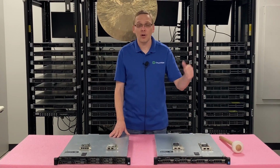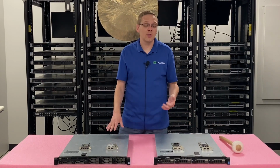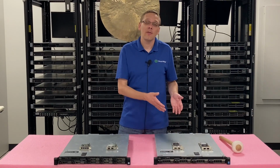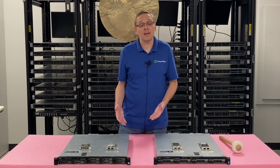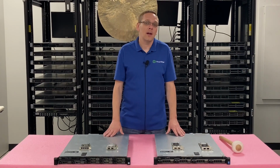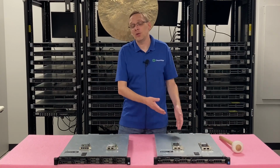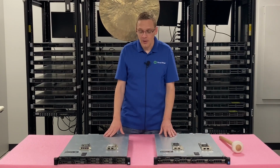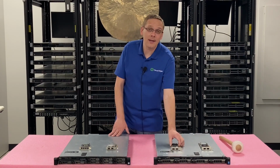There is a mini mono, as you see in our RAID video, but there's no carved out slot for the daughter card, which is actually one of the reasons, since we're talking about RAID cards, why you should use the mini mono, because you're limited on PCIe's for the R430 as a whole, so you really want to make sure that you can use them. So if you want to get, say, 10 gigabit or dual 10 gigabit or quad 10 gigabit, you definitely need to use the PCIe to achieve that. Or if you want fiber channel connectivity, you need the PCIe to do that. And so you definitely want to use something like the mini mono for the RAID to save those PCIe slots. So we've laid out some of the PCIe ones for you, and we'll show you the daughter card as well that it doesn't accept.